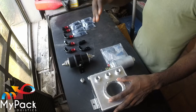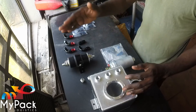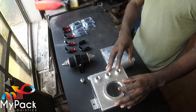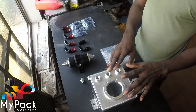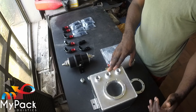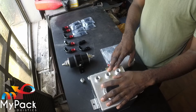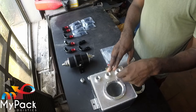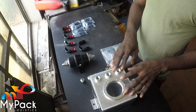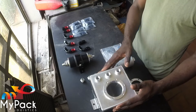You'll encounter fuel surge when you go through hard cornering and the fuel tends to swish away from the pump pickup — and in that you encounter a surge. With the surge tank, what happens is fuel is pumped from the main tank to this tank, it fills this tank and then overflows and returns to the main tank, so this tank will always stay full.